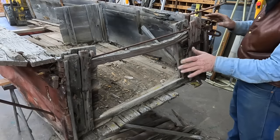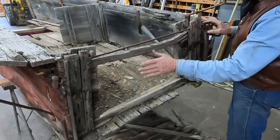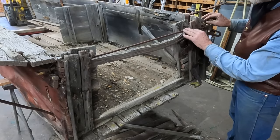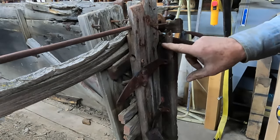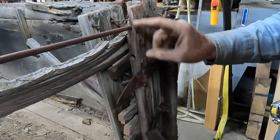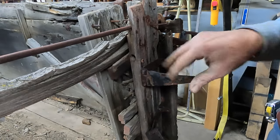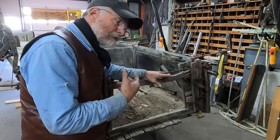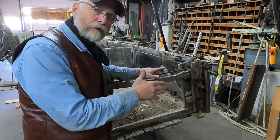Well, in past videos, you've watched me build these wagon boxes, and this cross rod is very common to keep these two sides solid, usually with a grain board that would allow opening to dump the grain. Well, this rod here wasn't originally in this place. As we get in here a little closer, you can see the original hole for this rod was down here, which it would have been in line with the original sideboard. But when this was extended up, in my speculation, to turn this into a sheep wagon, this rod was moved up to allow for some framework here to have this hinge door that would access into this grain bin area. So I'm beginning to see some of these construction styles that seem to indicate to me that originally this was a grain box wagon that was taken and adapted and transferred into a sheep wagon.